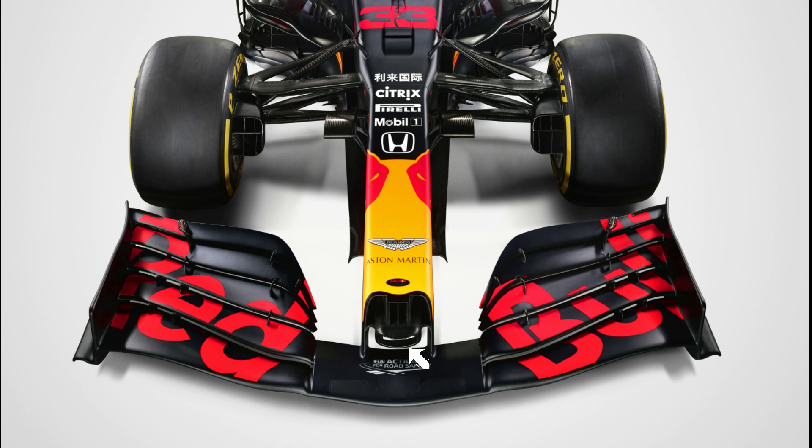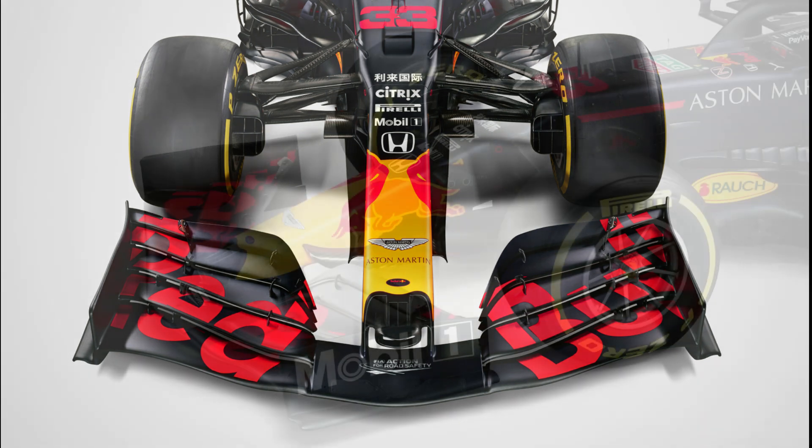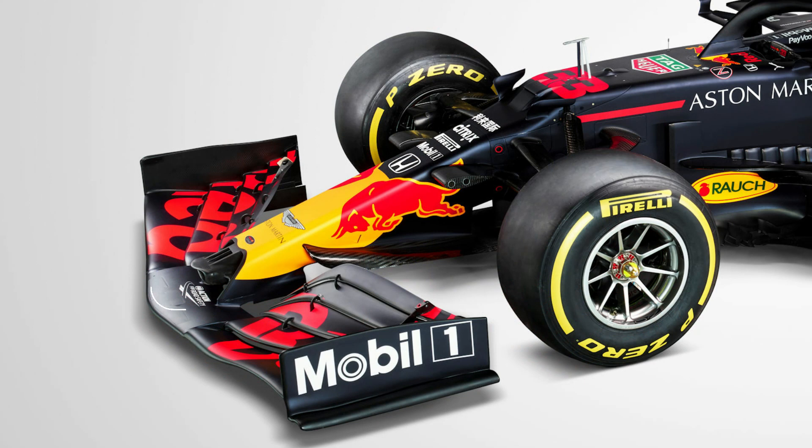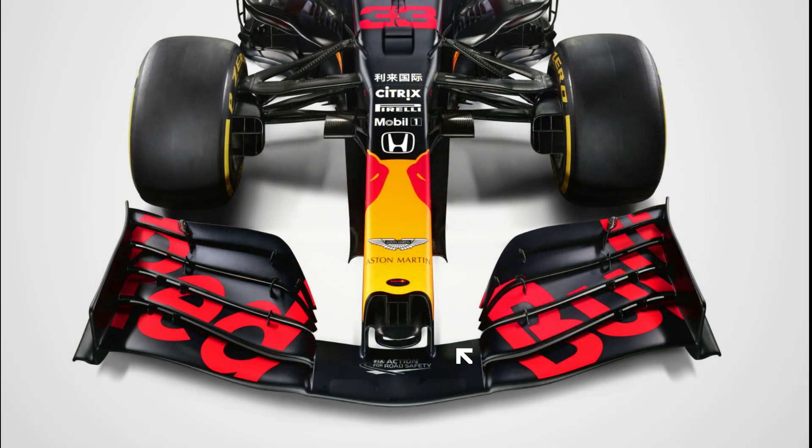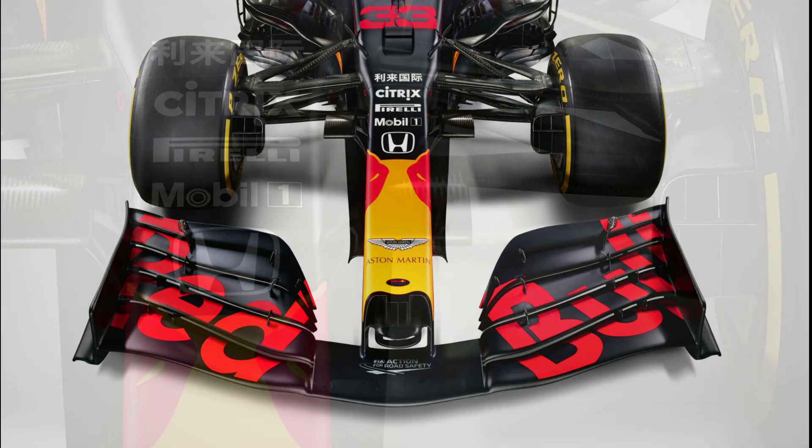The tip itself is still open-ended and more or less just there to appease the dimensional regulation requirements. However, it now features a flat peak that extends out over the top of the front wing's neutral section. Beside this, the nose tip has been joined to the sides of the front wing pillars, enclosing the upper section and creating a sort of snowplow arrangement that will funnel airflow rearward. On top of the nose tip, there's a narrow ramp section which also has two inlets present within it, helping to fulfill the single section rules and further enhancing flow through the nose assembly.